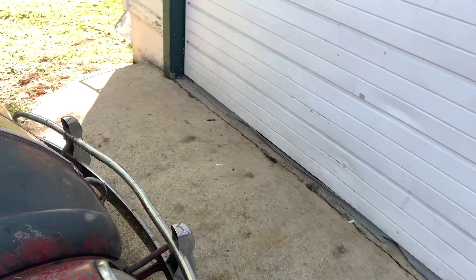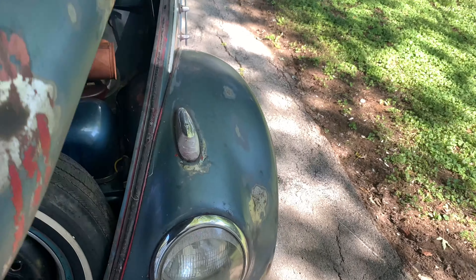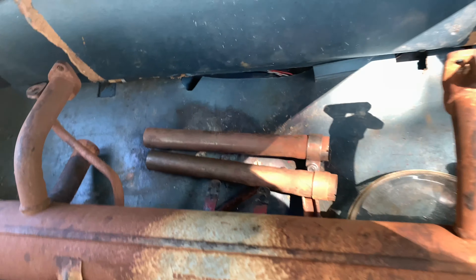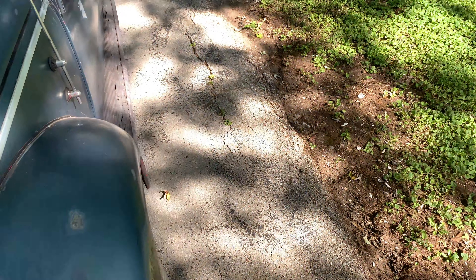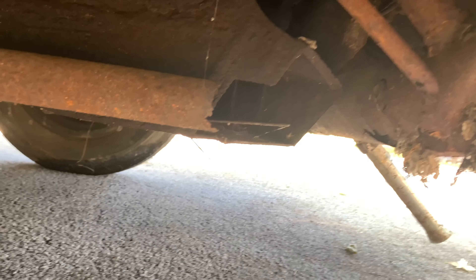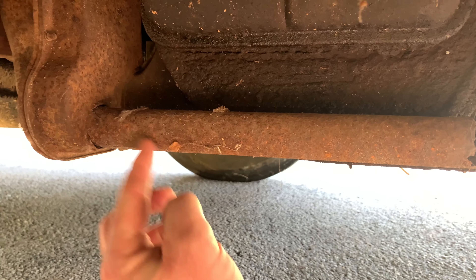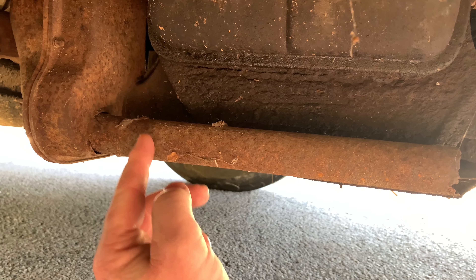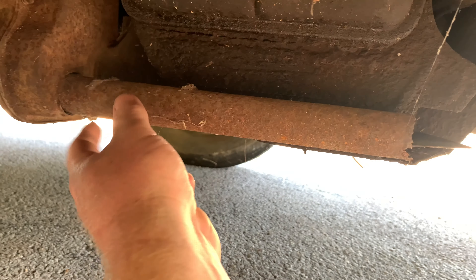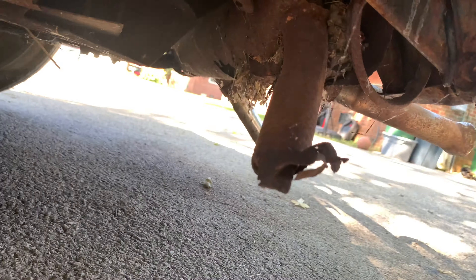Another thing I was able to acquire — and I don't know if I've already posted it in another video — is I have an original German 36-horse muffler and then these two pipes right here to replace the rusted-out sections. I believe they're supposed to slip over back here — you cut it off, slip it over, clamp it — but I'm just gonna chop it wherever need be and weld it up, grind it down so it looks all factory original.